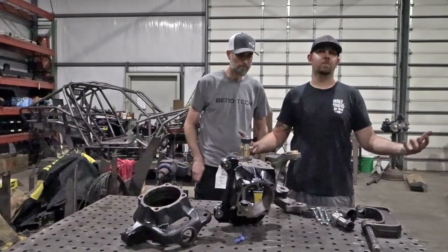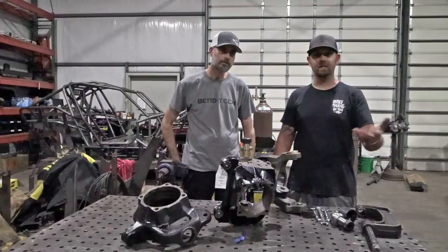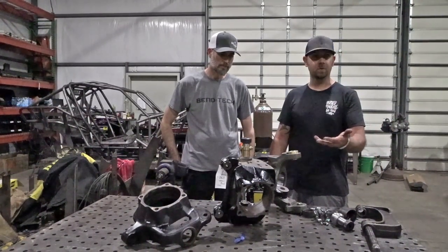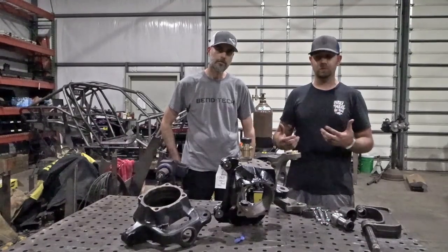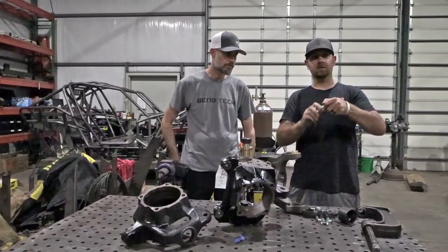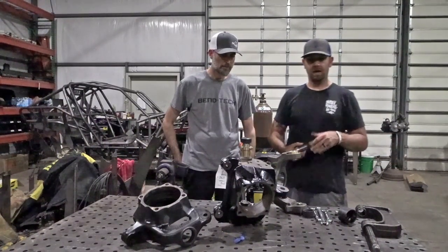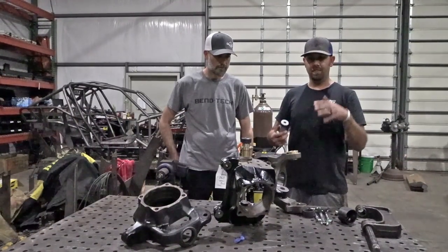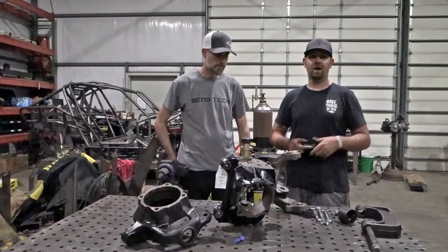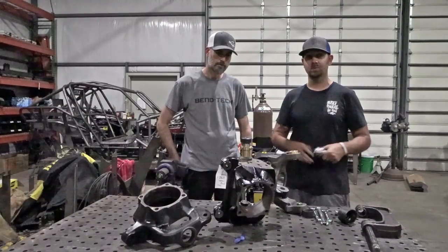So the first thing is why you need them — what is a ball joint eliminator? It eliminates the ball joints in a bunch of different off-road applications. Our specific units are for 2005-and-up Super Duties. When you get rid of the upper ball joint and go to this really big heavy shoulder bolt, this machined piece of steel with threads on the bottom, and this bronze piece, it becomes an extremely strong unit. Once that ball joint is eliminated, the entire assembly becomes extremely strong, allowing you to run a lot bigger tires without failures, take harder hits on the front end, and also run bigger axle shafts.